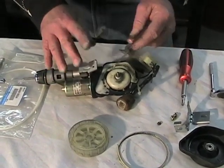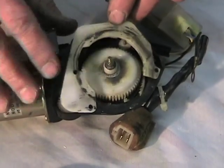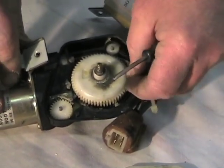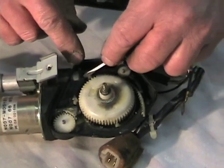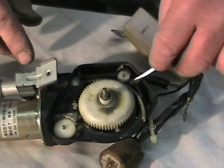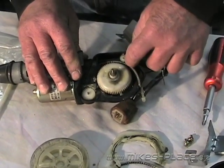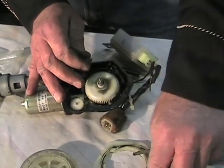But we're not finished yet — there may still be broken pieces inside. We need to lift this plastic cover right here, and there's another piece. If you don't go deep enough and clear out this second broken piece, you'll never be able to get a new one in because it's stuck right at the base. Don't get fooled by not cleaning completely the antenna motor assembly out. There's a little wheel here — pull that wheel out and get that last broken piece out.